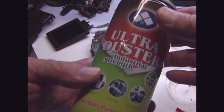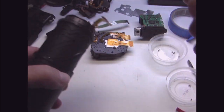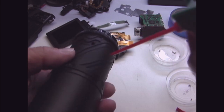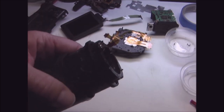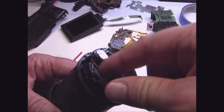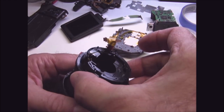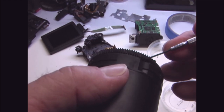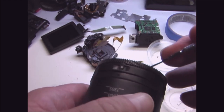I'm going to use this can of compressed air to blow all the contaminants out of the lens. When the lens is fully extended, it is possible for this part to slip out, so just be careful of that. As long as the lens is at least halfway closed, it can't come out. Also check these gear teeth around the perimeter to make sure there's no debris caught in them. On the backing cover there are two gears — you also want to check these for debris. It looks like there's some sand on this red gear, so be sure that's cleaned out.